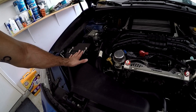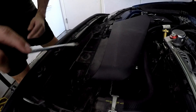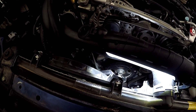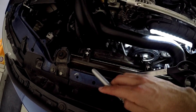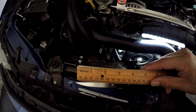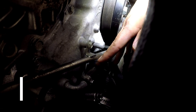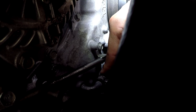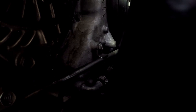Then we'll go into cutting away at your turbo sump hose. You're going to want to remove the vent to your air box and then get to that turbo sump vent hose. I'm going to use scissors to cut that hose. I've got a metallic sharpie to mark off two inches, scissors, and a ruler to gauge two inches off of that turbo sump vent hose — it will be this hose right here. It connects here, and I'm going to start where the actual metal portion of that line ends.